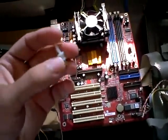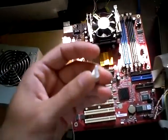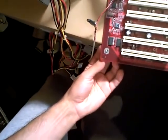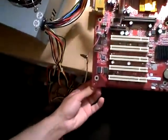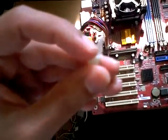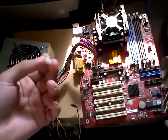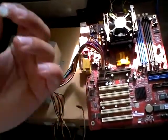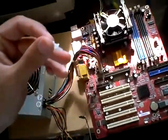Important to note: these plastic support stands are, for the most part, not reusable. So once you install them and place your motherboard on them, the pins on the plastic support stands fit through the port holes on the motherboard. These snaps will engage, and disengaging them is very difficult. Chances are, if you try to remove these plastic support stands and make a mistake, you'll break the snap on them, and they are therefore not reusable. So if you're going to go this route, maybe it's a good idea to buy multiple.